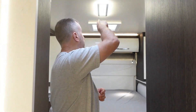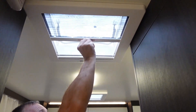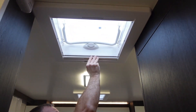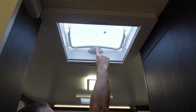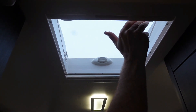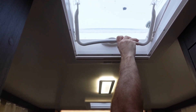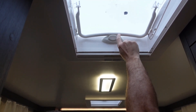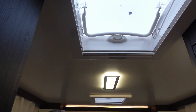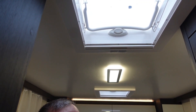You have two roof vents in the vehicle. Each has a fly screen and a night blind. To open them, push the button in, pull the handle down, then move it to the side to open it right up — or you can have it half open. To shut it, make sure it's back and clicked. Always make sure these are shut when you're travelling — if you don't, they'll get damaged and the fly screens often get broken.